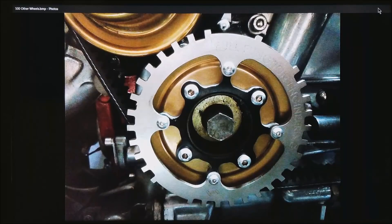Here is the hall or VR sensor. Remember that this has to be solidly mounted to the motor. Also keep in mind that this ring really should be in the solid part of the harmonic balancer and not mounted to the rubber moving part — that might be enough to give variation in your timing. One thing I like to do when bringing one of these up from scratch is have all 36 teeth on the wheel, mount the sensor anywhere that works well on your motor, and then later cut out the tooth that works out about 60 degrees before the beginning of the compression stroke.